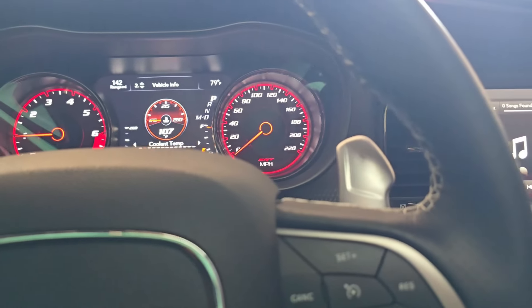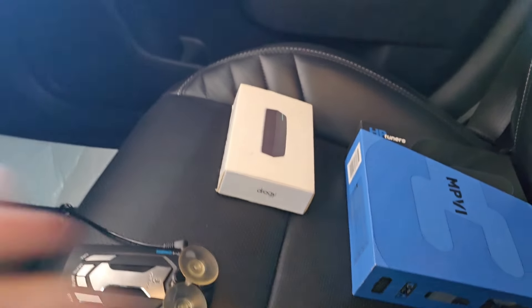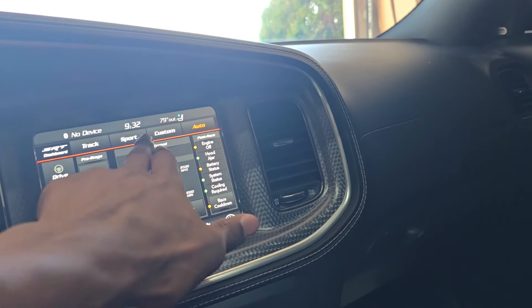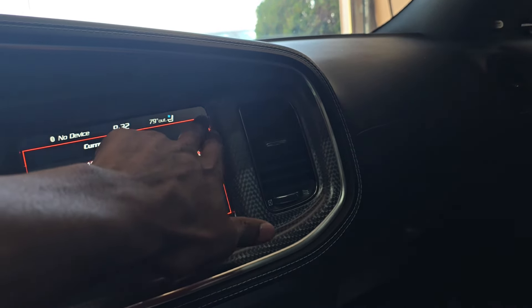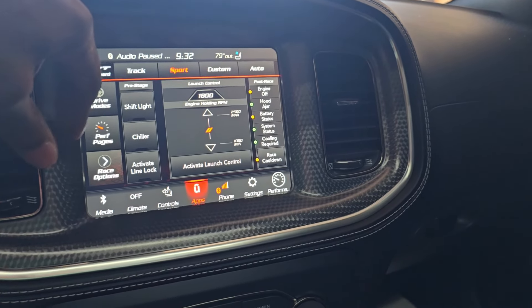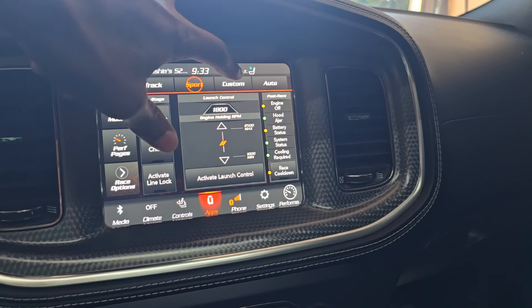We are back - it is the next day. Finally put the little HP tuner, MPV1, to use and uploaded the hot tune, the power unlock. Yesterday we were only seeing like five pounds of boost - all that should be corrected now. The tables were inverted, so it was trying to keep me in 500 horsepower mode and bleeding off boost like crazy. Now we got all the beans.